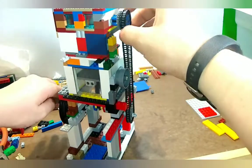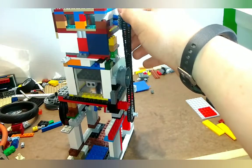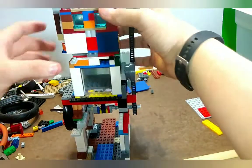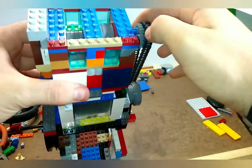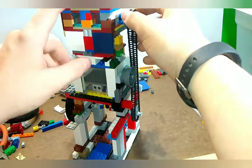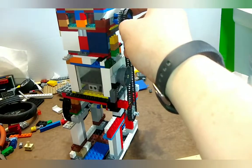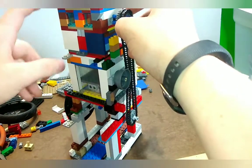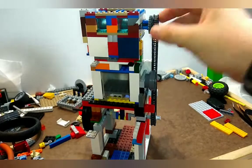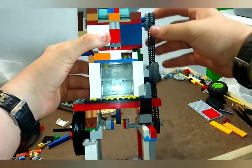He showed me his proof of concept a few months ago, which is how I know his is the very first one — he showed it to me at least six months ago, so he has had his design out for a very long time, just never before seen publicly. As you can see, it has real cam lobes which are very realistic. The only difference is the cam profiles — real engines have different cam profiles, and that is actually what VTEC is: switching between a different cam profile. Recording was briefly interrupted when I ran out of space on my phone.